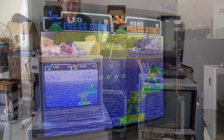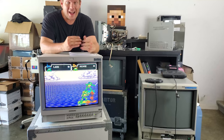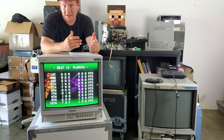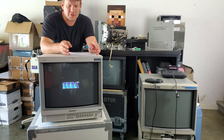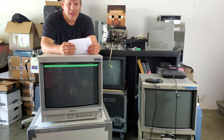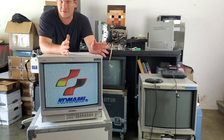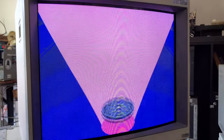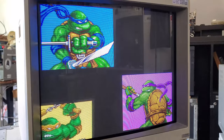You do have a limited deflection yoke — it's not as adjustable as the higher end PVM and BVM yokes. It's not that it's a bad yoke; there is just a more complex and adjustable yoke available from Sony that was not used in this monitor. Finally, these are getting expensive and can easily cost over a thousand dollars for one that hasn't even been serviced, and having one serviced can add another few hundred dollars to that price, so they are highly desirable but definitely condition dependent.